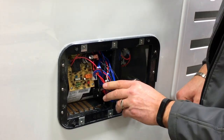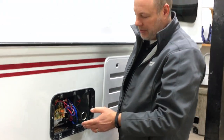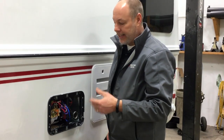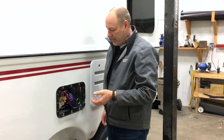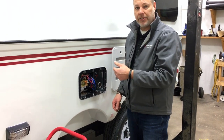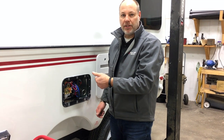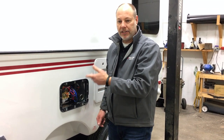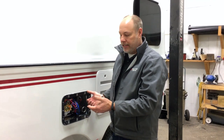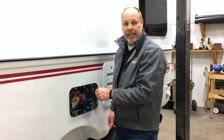A good indicator that it's your sail switch that's the problem: you turn the furnace on, the fan comes on, it runs for exactly 30 seconds, and then it shuts off with no ignition at all. Basically that's the sail switch. If you don't have enough battery power to turn your fan fast enough, it won't allow the furnace to move on to the next step of actually igniting. So if it's not happy with the sail switch you won't get ignition at all — 30 seconds it runs and the fan shuts off, nine times out of ten it's a sail switch issue.